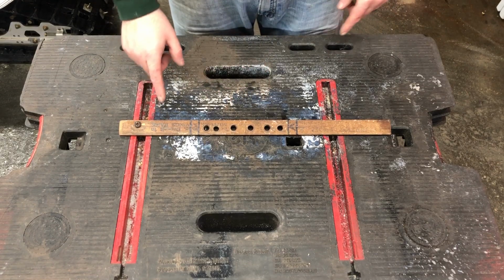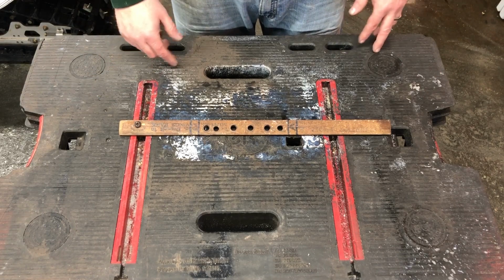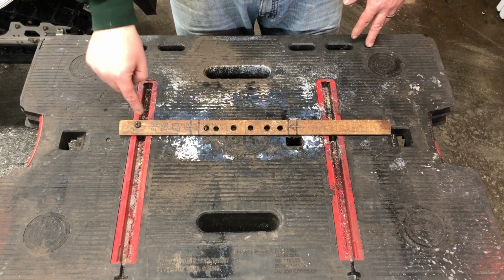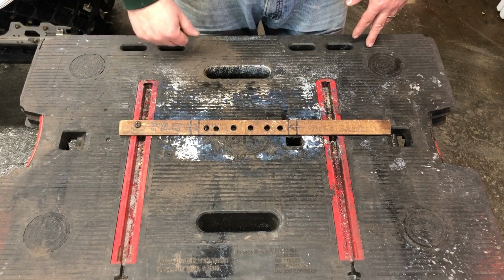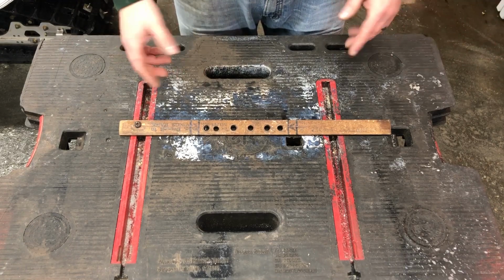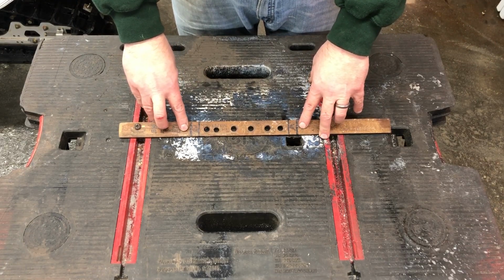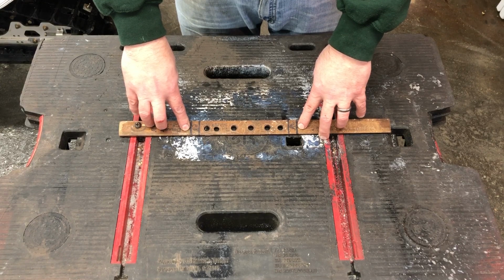So what I've done is I've taken a yardstick, I've made a pattern, I drilled a hole through the top of the stick, and I inserted a bolt through it, so it'll allow me to hang the pattern on the track while the sled's on its side. And if we look, I have a couple lines. Basically, these 2 outside lines represent where the window on the track occurs.